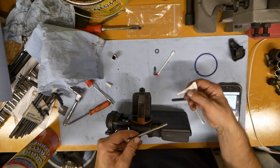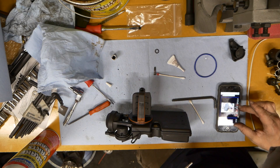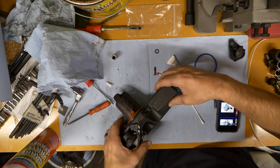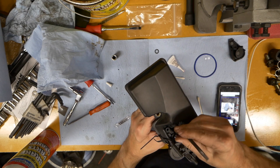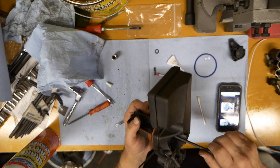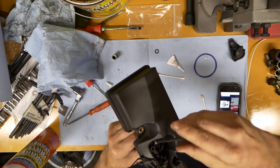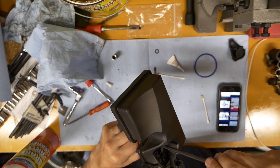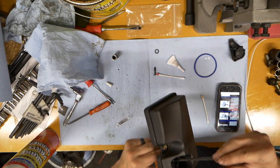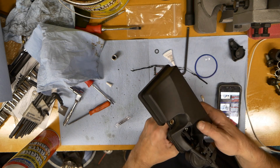Just a little dibbity dab here. Hold the flapper closed while tightening the screw. So I've got to shove that all the way in here and it is through. So it came right through — it's stuck in there now. You have to hold this flapper closed while tightening it. That's got to fully seat in there. I can feel it tightening up. You don't want to put any pressure on the actual DISA valve itself. So that's good.